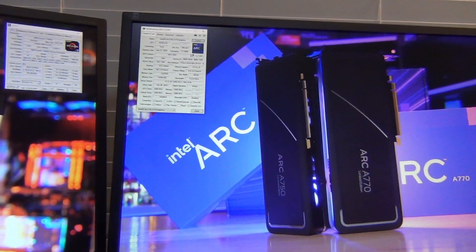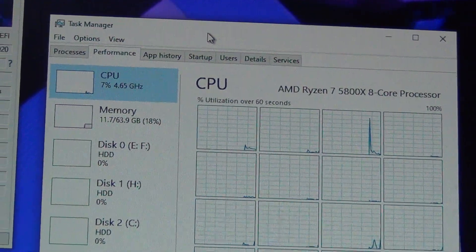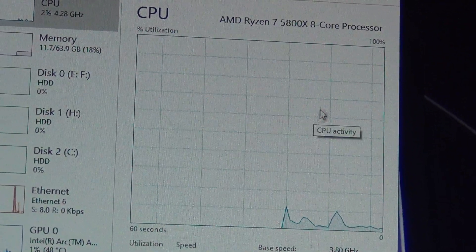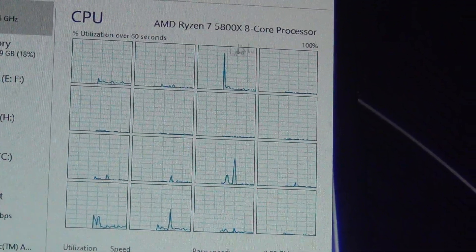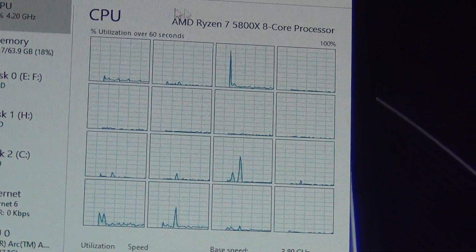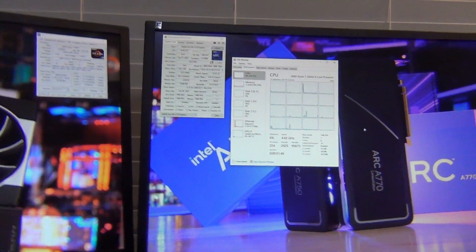To find out what CPU you have, simply open Task Manager with Control-Alt-Delete. Click on Performance, then CPU, and it will show your processor. You can right-click the grid and click 'Change Graph to Logical Processors' to see how many threads you have. In this case we have an 8-core processor with simultaneous multi-threading, so 8 cores become 16 threads. I can already tell this is an AMD Ryzen 7 5800X, which does support resizable BAR.